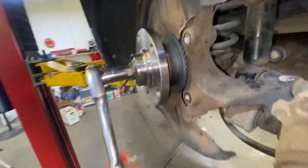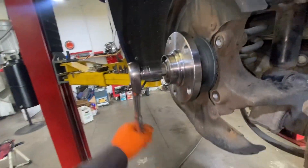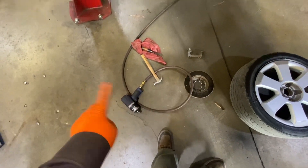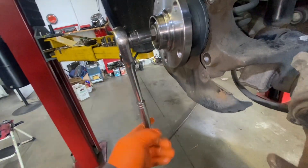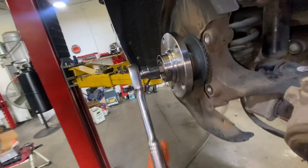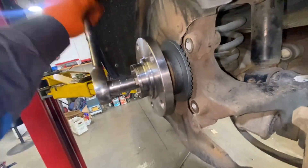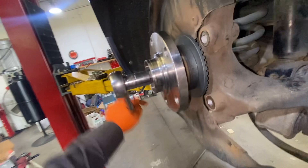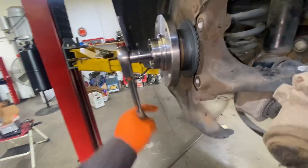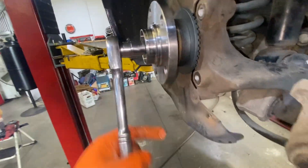You put back the bolt with your hand. Do not use an air gun because it may damage the nut. So use the ratchet with the socket and just take your time. Do it easy, really soft. And please guys, remember to not use the air gun.